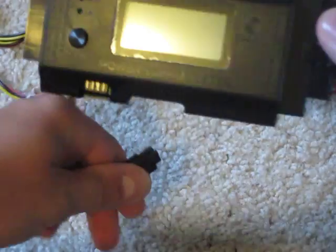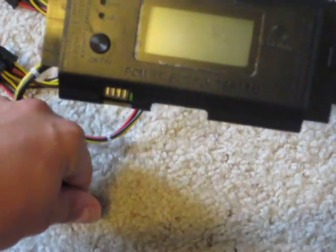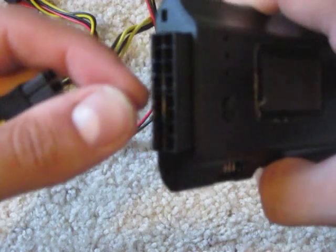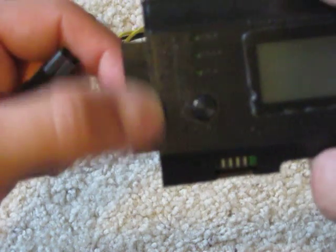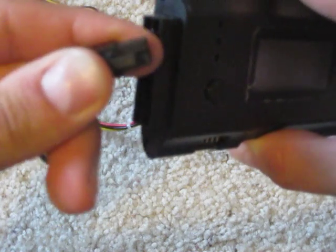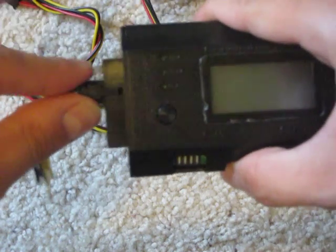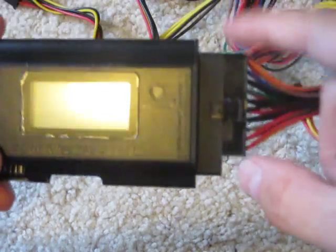The second thing you're looking for is this 4-pin connector, which is also plugged straight into the motherboard. This goes on this end, and as you can see it's kind of divided in two areas and it's also labeled. You want to plug this in right here. You have this one plugged in, you've got this one plugged in — 20 or 24-pin — same thing. Just make sure that it's aligned right.